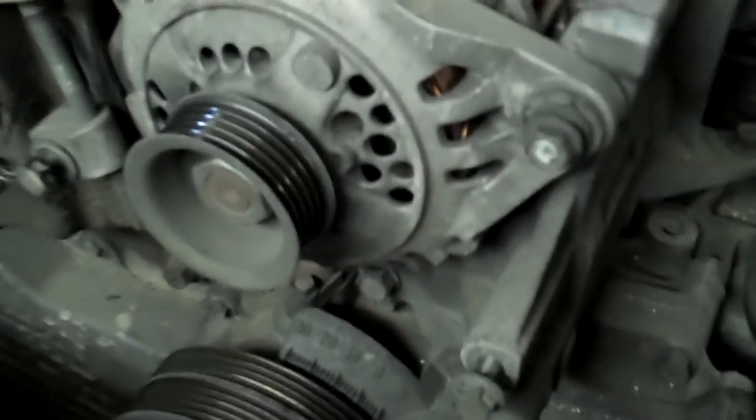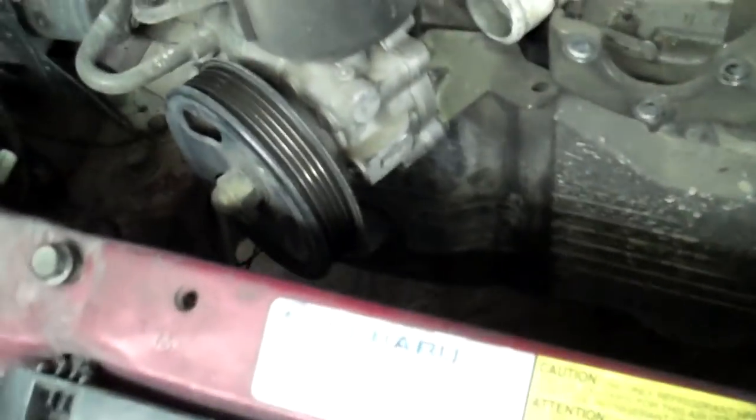The first thing that I like to do is drain everything. You drain out the oil and the antifreeze. The antifreeze drain cock, as you're standing here, is down on this side. The radiator's gone now, but you drain the radiator from this side. I like to put a little hose on it, drain pan it, and then I unplug this electrical plug here for the fans on this side and the electrical plug here for the other side.